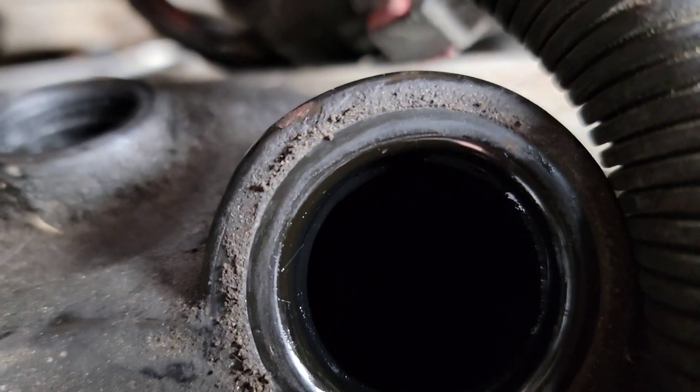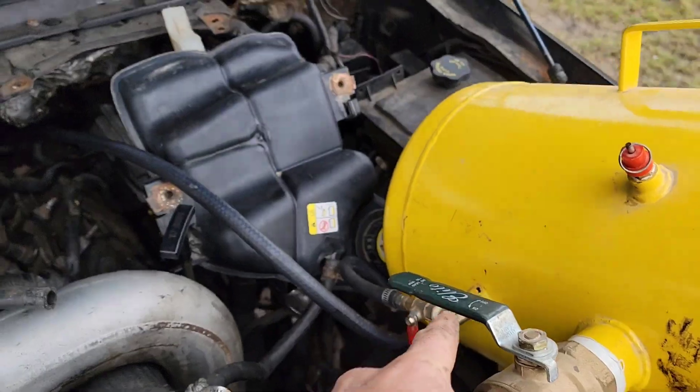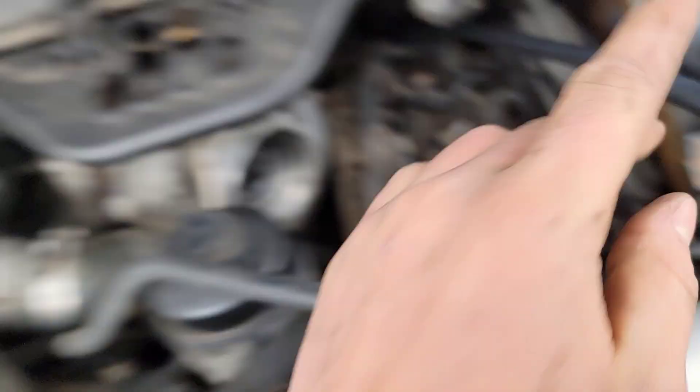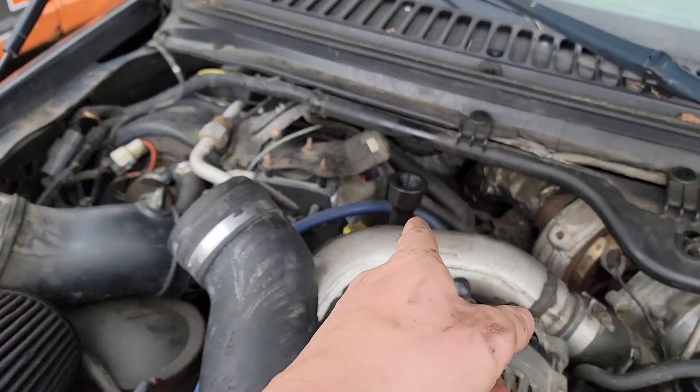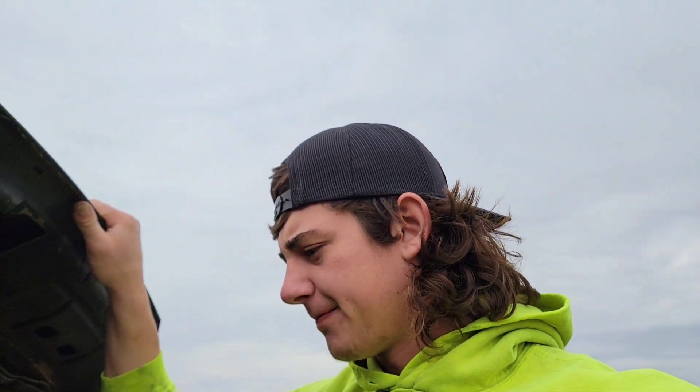You hear the oil bubbling? So we did the test — I turned on the valve and put my ear down in there, and I can definitely hear it in there, and definitely hear it in the other side too. I wonder if it's not the injectors — I know one injector is going out, probably the injector o-rings. So we're gonna try that. We'll pull the valve covers off and do another air test with the valve covers off in the next video.